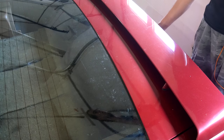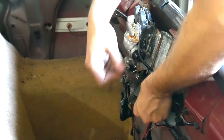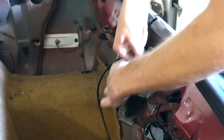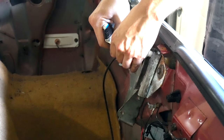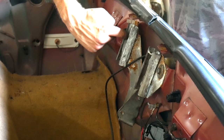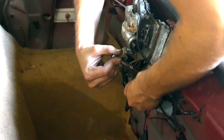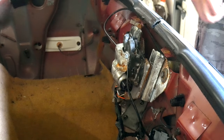For now we're just going to replace the guides since they should fit. We'll pop the hatch open and take the pull-down assembly apart, this time removing as little as possible - just the three gearbox hold-down screws to slide the whole assembly out of the channels on the body. Then we can knock off the crusty old guides and get ready to install the new ones. We'll clean out the old grease and polish the channels up just a little bit with some red Scotch-Brite, then clean them again and apply some brake grease. After that's spread around evenly, we'll pop the four new shiny nylon guides onto the pull-down assembly and slide that back into place, reinstall the screws, and test the unit by manually depressing the latch switch. The movement is smooth now and doesn't wobble all over the place.